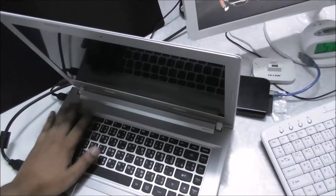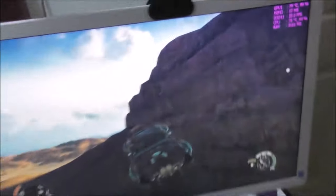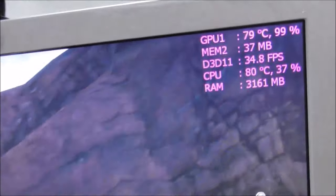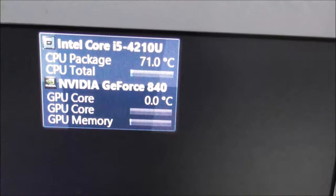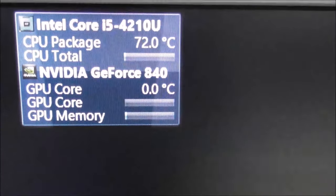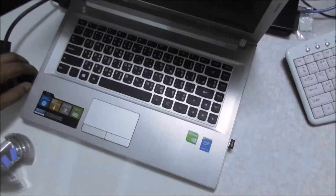It's too hot to touch. My room temperature is 28 centigrade and when I touch the laptop here it's very hot. It's almost 79 and will go to 80 centigrade, but it's still stable. Now I'm going to shut down — Alt+F4 to close the game. As you can see, the GPU temperature drops to 72 suddenly. The GPU is a GeForce 840M and the CPU is a Core i5-4210U. Temperature is going down now.